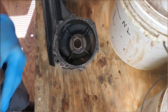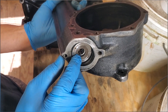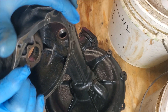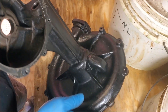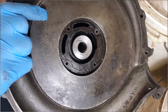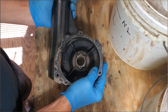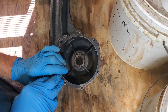Now we're going to show you the Babbitt in the supercharger. Down in here we've got brand new Babbitt. This is a pinned washer — it could be removed. You can see brand new Babbitt in the second bearing at the bottom, brand new Babbitt at the middle bearing, and a beautiful job of brand new Babbitt at the top. All three of those bearings had to be re-Babbitted and have been done. The shaft has been turned down so it fits — everything is in original tolerances. Now we have to do the job of making that floating washer.